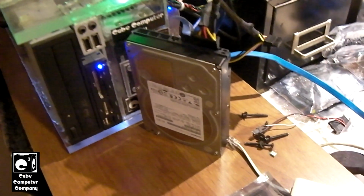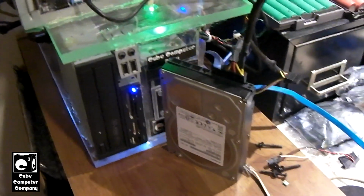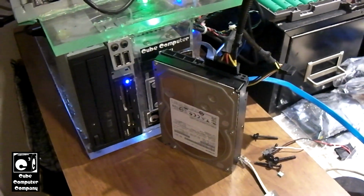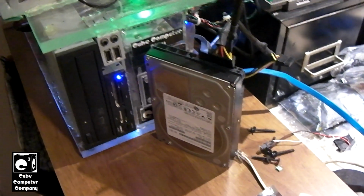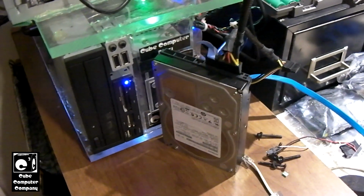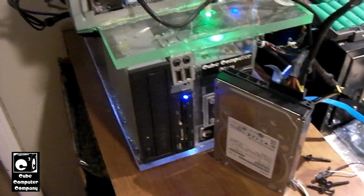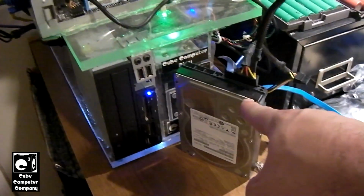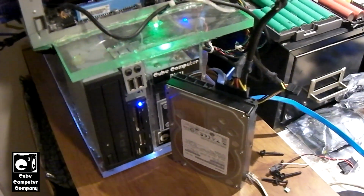Okay, so currently I have a standalone 2TB drive hooked up to the Plexi. I'm in the process of offloading the user profile contents to this hard drive, as well as some data backups I have on there, because we've got to trim down the contents of the C drive to be well within the size limits of a 240 or 256GB SSD. So all the stuff that's getting offloaded onto this drive will ultimately end up on the 2x2 RAID1 setup that's going to be in this thing. So the first step is to, again, offload the excess stuff from the Plexi C drive onto this drive here, and then I'm going to make a copy of the contents of the Plexi C drive onto a new SSD, and at that point we'll begin doing the actual install work.